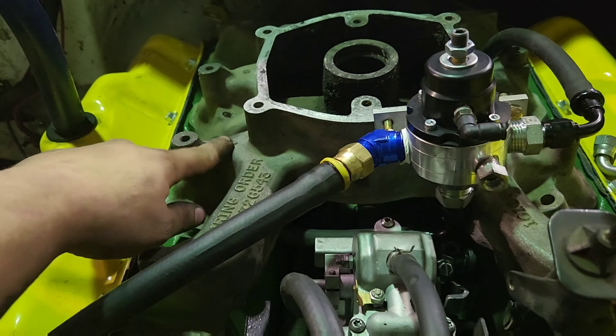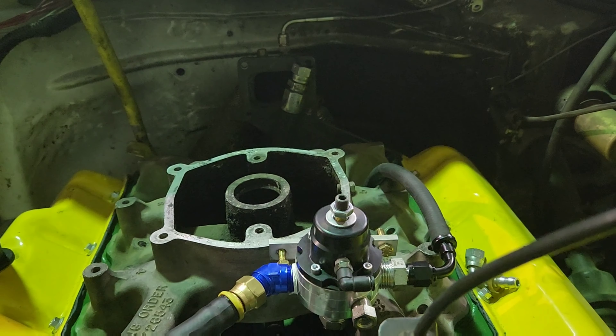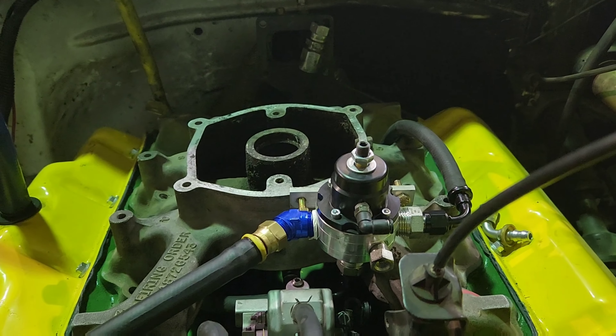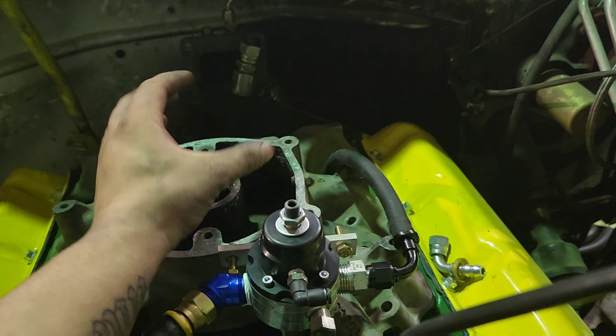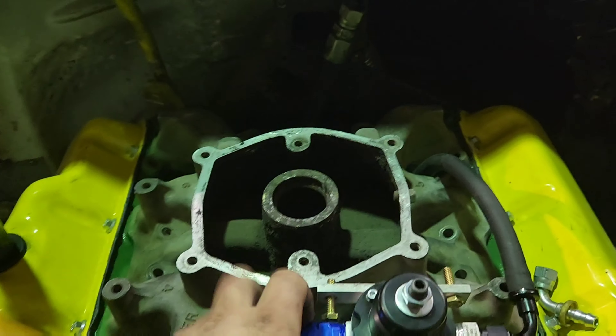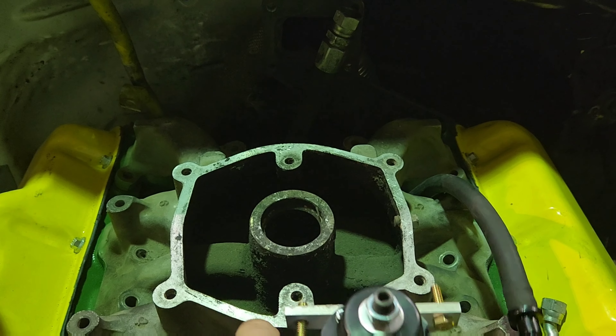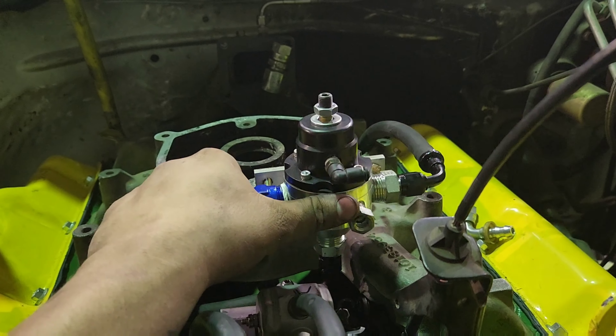I always butcher their name — it's a marine upper intake that came off here from my intercooler piping, which it doesn't clear with something I'm going to show you in a second. So that will end up going on the dually. I'm going to end up making a flat one with a pipe and a V-band for clearance issues. And once I do that, I'll have little L brackets that bolt to this, and bolts that guy about there.